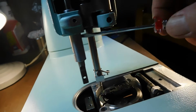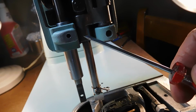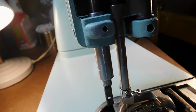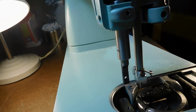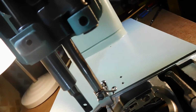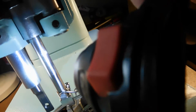When the needle bar is at the bottommost point, right here, like a 1/16 of an inch or so below the bracket, that timing mark is exposed. But you have to time the hook on the upswing, when the needle's coming up and that little mark is just disappearing into that holder right here. You may be able to see that. I'm just looking at the back of the camera. I can't see for heck.